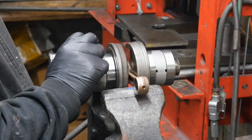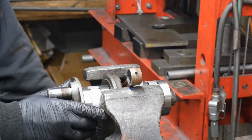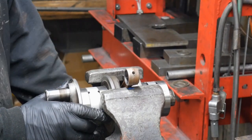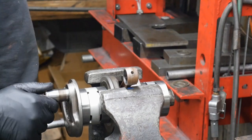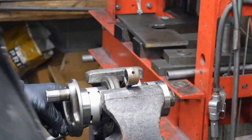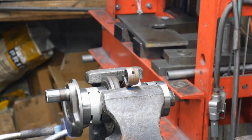That's it, as long as you don't suspect that the crank has a severe beating. If the rods were pounded away on it, there's a strong chance that the pounding twisted the crankshaft. So you have to be careful of that. This is more only if the crank is in relatively good condition.